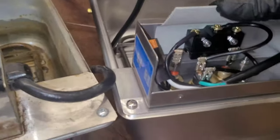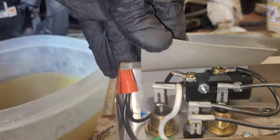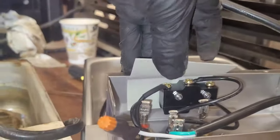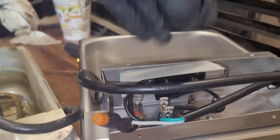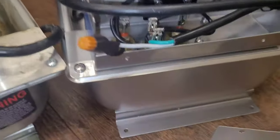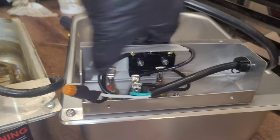Use the existing wire instead of messing with the caulk they've got back there. This is very simple 110-volt wiring. It's going to feed the left side of that switch just like this one does — feeds the left side of the switch, and then neutral to neutral. This one has neutral feeding the left side of the switch; this one has neutral coming to the element. It really doesn't matter — you could do it either way. You could reverse neutral and hot on the two posts and it'll operate the exact same way. I personally prefer neutral going straight to the element.